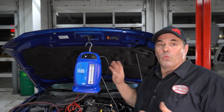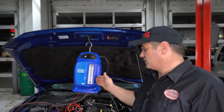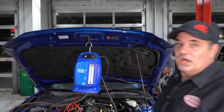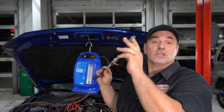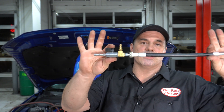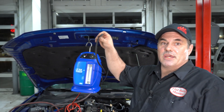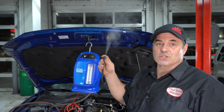Well, depending on the vehicle, I have the OTC leak detector hooked up — a sponsor. What I've done is take a fitting out of my fuel system tester — just a standard fuel line connector, a junction block with another open end. You could use a different adapter, whatever your system has. I plug this into the EVAP line coming off the purge valve, use a short piece of rubber hose that's the right size, and start smoking.